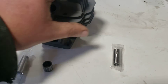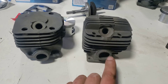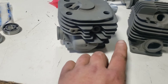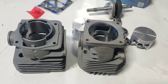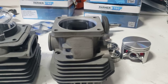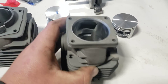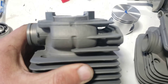People ask me all the time about porting. I'll tell you right now — it's a lot easier to port a Stihl and requires less tooling than a Husqvarna 372. We're only going to talk about transfer ports here, not intake or exhaust. When it comes to decking the cylinder, I've seen people stick the Stihl cylinder on a sander and start decking it. I like to use a lathe, but the point is it can be done with less tooling on a Stihl.